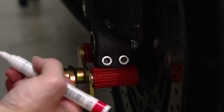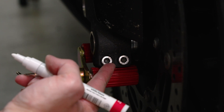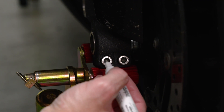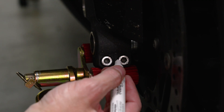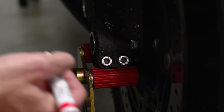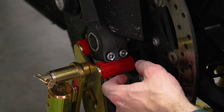What I like to do is come in here with a paint pen and actually mark the bolt to approximately where I want the wire to go. Now everything on this is already torqued, so I know when I re-tighten these bolts it's going to be in approximately the same spot. So I'm going to want some wire right through about here, and this next one I'm going to wrap around and it'll be about right there. Using a paint pen isn't mandatory, however I've done this more than once and I've learned that for me this is the easiest way to do it, so I don't have to guess if I've drilled the hole in the right spot once I have everything installed.